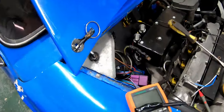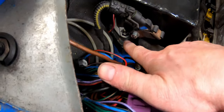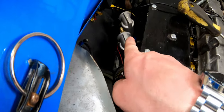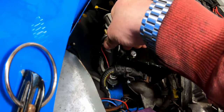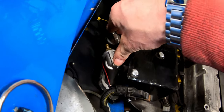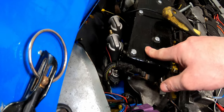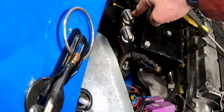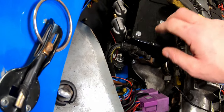As you can see down here, there's a little piece - that's a clutch and brake master cylinder. They're ones for remote reservoir. You can see how close they mount just there to the manifold. Not quite bolted down fully, but that's roughly where they're going to sit. I may well modify this box just to give it a little bit more clearance, because there's plenty of clearance with the clutch, but not so much with the brake master.